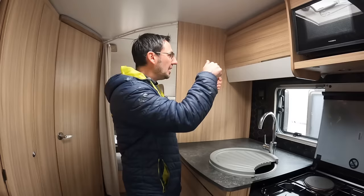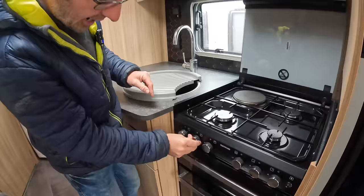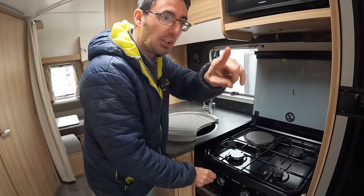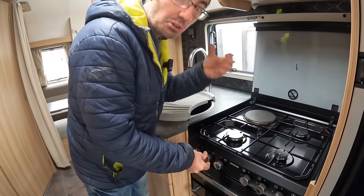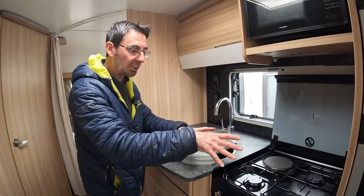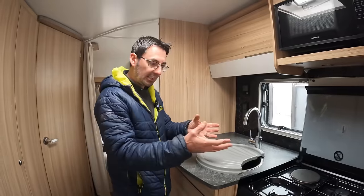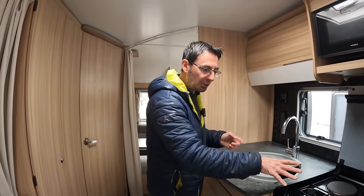Things may have seized up a little over the winter. Turn one gas ring on — make sure your gas bottle is on and the little yellow tap is in line on the regulator. Hold your gas ring in the on position and you should hear it start hitting through; if not, work your lid backwards and forwards and that should work the switch and start getting the gas through. Light up your three or four hob rings first, then light your grill and oven so you can physically see and hear that you've got gas coming through the system. Do the fridge and heating on gas afterwards.